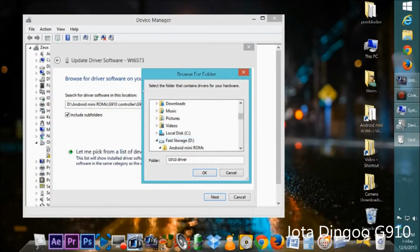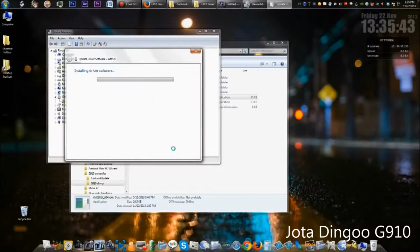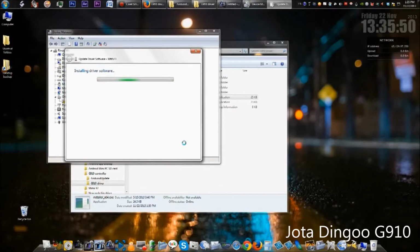Now these are unsigned drivers, so if you're using Windows 8 you need to go into unsigned driver mode, and I'll put a link to how to do that in the description below. It's fairly complicated. Now here I'm installing it in Windows 7, and you can see you just get this red warning box saying the driver is unsigned. Just go ahead and accept that, and then it will install the rest of the way.